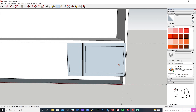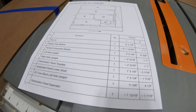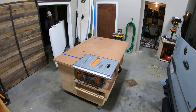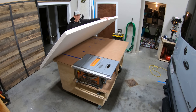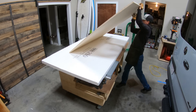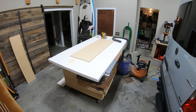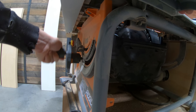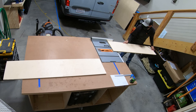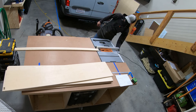With a complete plan in SketchUp, I knew what size to cut the boards, how they'd attach together, and I could export a cut list for efficient plywood cutting with minimal waste. I laid a 2-inch foam board on my workbench as a support for my circular saw — a great trick for breaking down sheet goods. For this project, I'm using a 5-foot by 5-foot piece of 3/4-inch Baltic Birch plywood. After initial cuts with the cordless circular saw and straight-edge guide, I got the table saw set up for more accurate cuts, cutting everything about a quarter-inch oversized first.